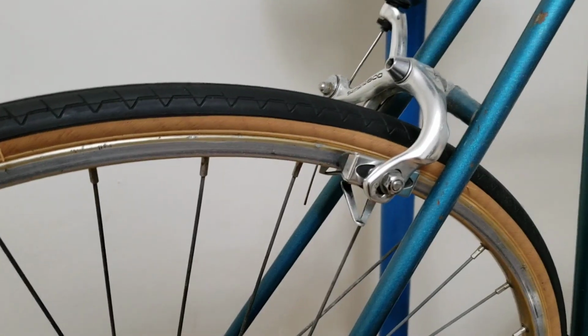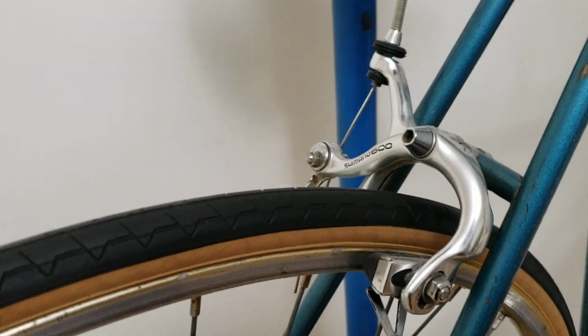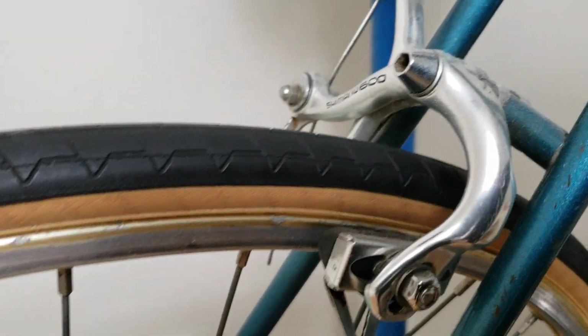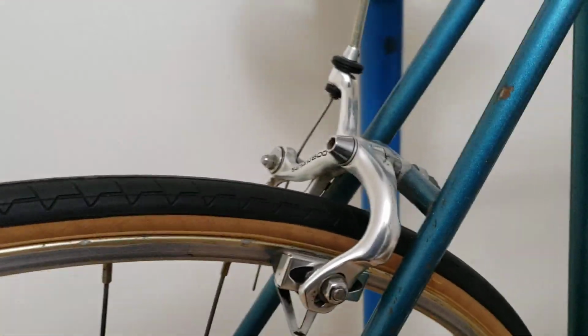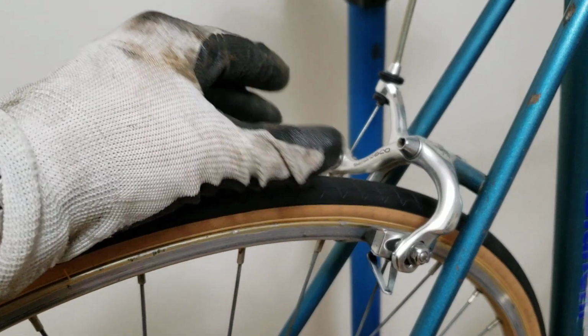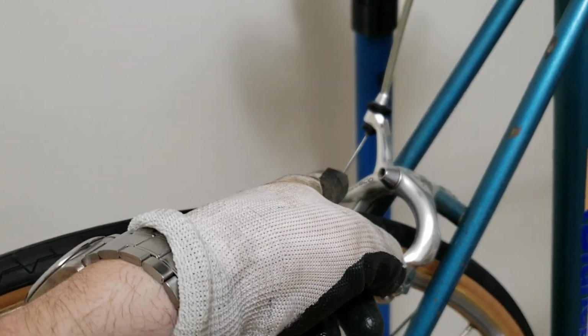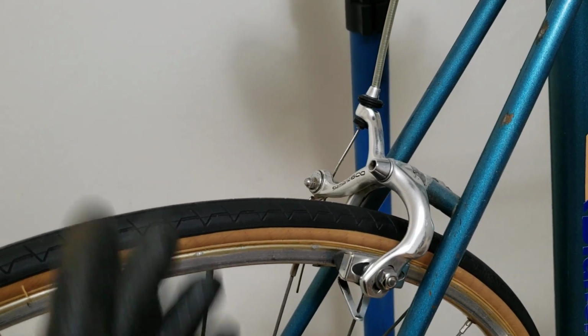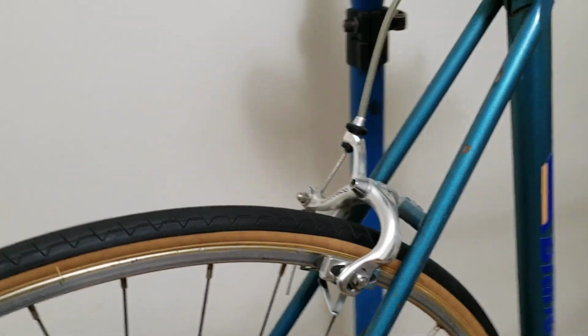Yeah. Again, we are back at this section of the bike, and I'm going to come here and press the brake. Now, speaking about the brakes over here, let's see if I can catch it on camera. See, what ends up happening, you want to make sure that the calipers are biting equally here. Both of them should be; you shouldn't have one seized and one pushing in. You should have both of them equally biting. So that's what you have to make sure.